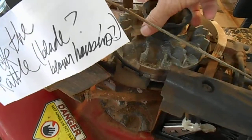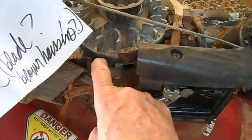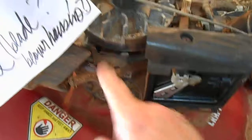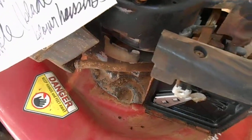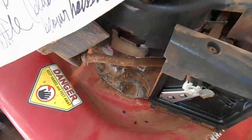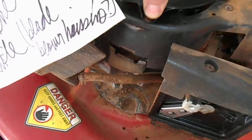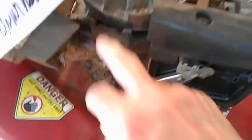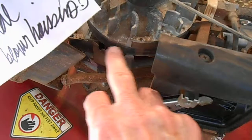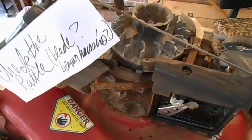What's happening is the magnet is pulling that housing in. So just make sure that when you reassemble it, you bend this away a little, and when you put this housing back on, make sure these little dog ears go where they're supposed to. Set it up so the dog ears are seated correctly and this thing's not being pushed towards that magnet, and that'll solve that rattle.